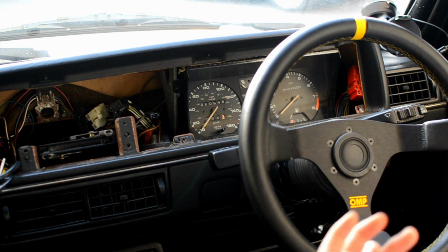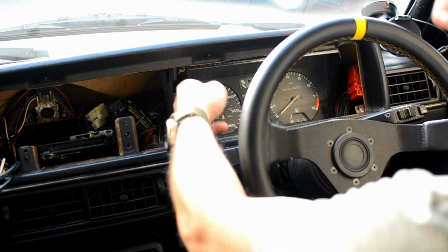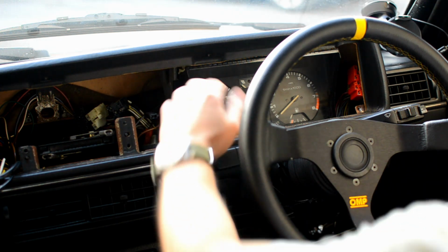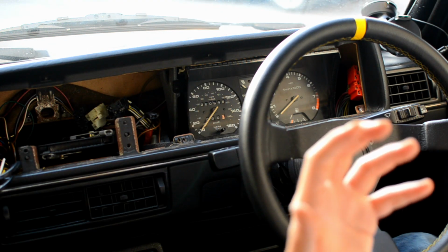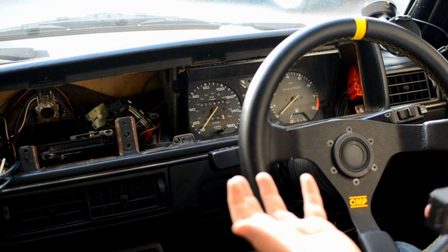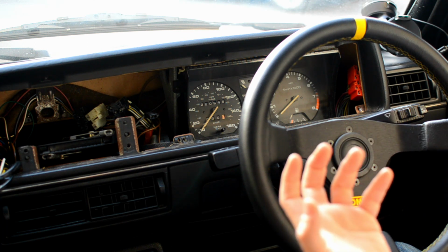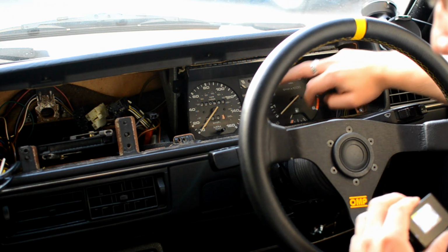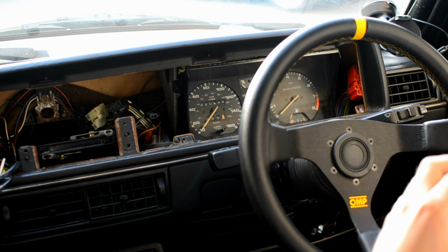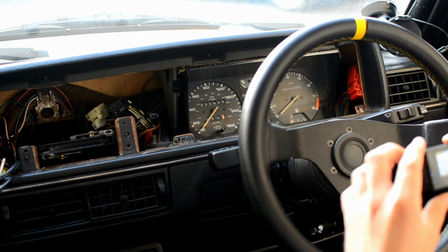The harder parts to do are the speedo cable drive, which is in the back of here, literally right in the middle of this one, right in the middle of the odometer and speedo. And then if you've got a GTI, you've got a vacuum pipe right around the middle at the back, right around there, which runs your MPG. But we can reach them and get that, and I'll talk you through them.